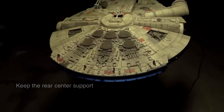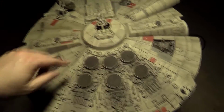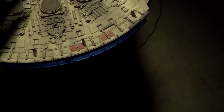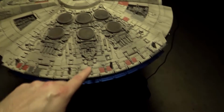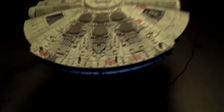Underneath the hood here, if you use your imagination for a moment, there are four key supports back here. Okay, when you put in the turbines, you lose one of your back ones. When you also cut away here, you're losing some of the ones along the side. So you're pretty much supportless all the way south of this turret right here. You pretty much lost all your support. This is about the only one that you're going to have that's going to have a screw underneath so that you can close this up. So it's instrumental that you keep that, okay? Very important.